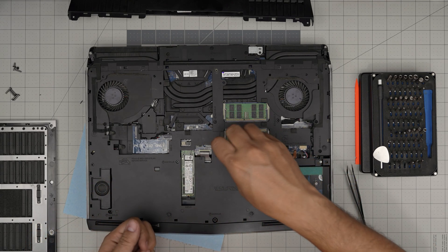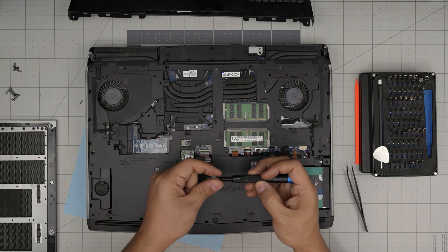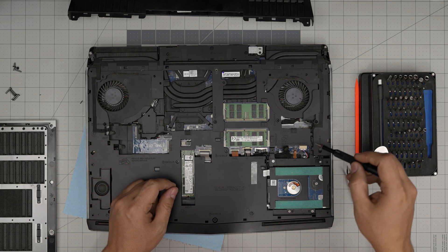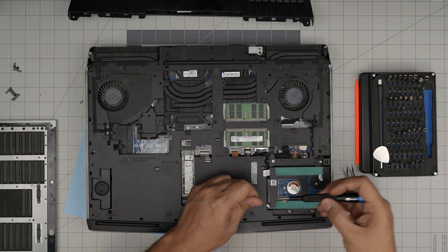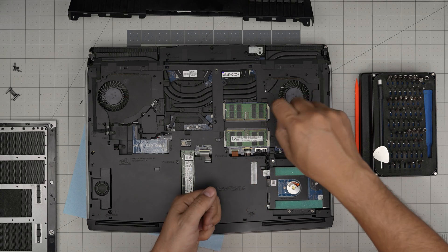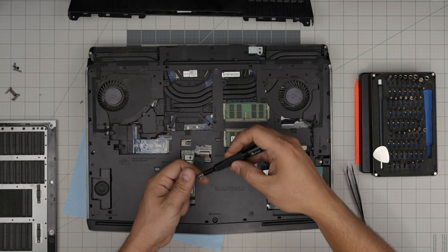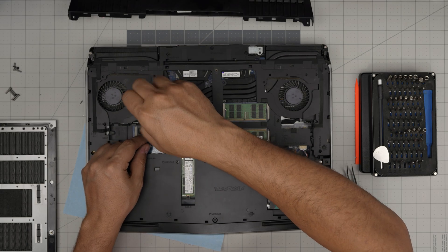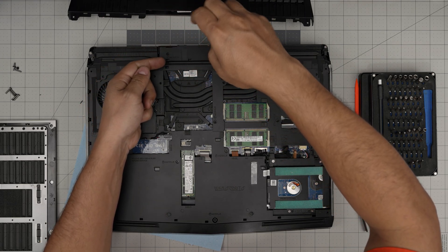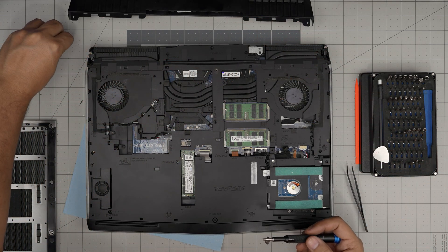I can see one, two here, three right over here. I've attached a little magnet to my screwdriver to make it more powerful. Remove the screw by the fan, one right in here, one to the right, one by the fan in the middle, one right there by the Wi-Fi connector, and three at the back rail once you remove the gray cover. Put them all in one pile.